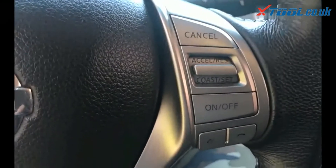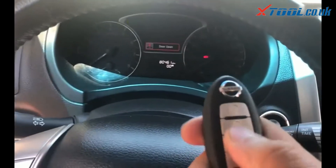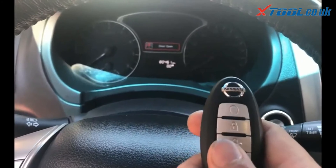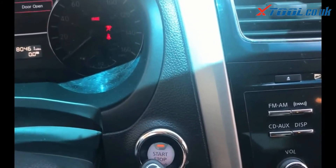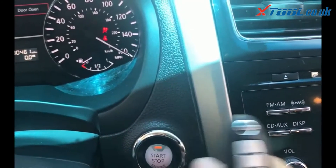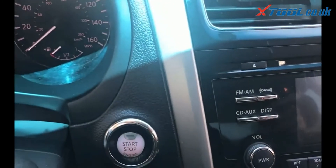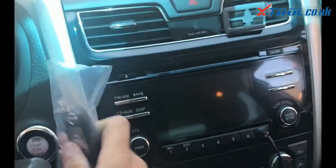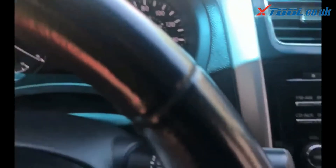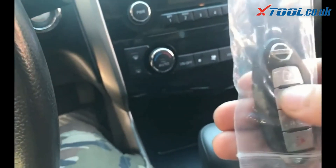See: key registration complete. Now, this key is bad — remember, sometimes you might check that the battery is bad or the key itself is bad. Usually what you can tell: if it's bad, put the key right next to it and try to start it. If it works only when close, that means it could be the battery or the smart key itself. This one works, so of course if I start the car without it close, it starts. Also unlocking and locking to verify — so it's all good.